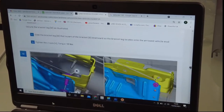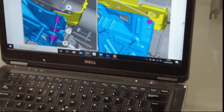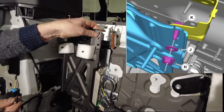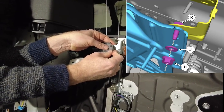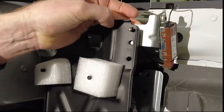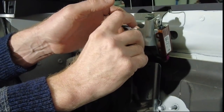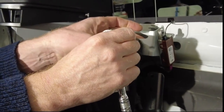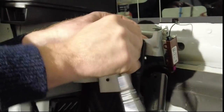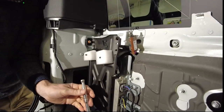We've got the bottom bracket on. For the top one we need a K, a J, and an H to line all that up. That is our bracket all fully installed now. It does give us the torque setting — I think it was 10 Newton metres. We'll put it on the screen. And make sure we get the amplifier brackets on there too because you'll miss those otherwise.